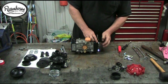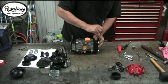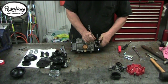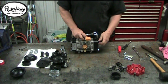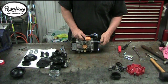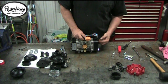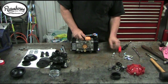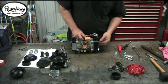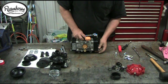Pull these off using a 19mm wrench — there are four per side. The D30 and AR30 are the same pump; they just changed the name. Some will have studs and some will have just a bolt. If you have studs, just take the nut off the same way — it's the same 19mm size.